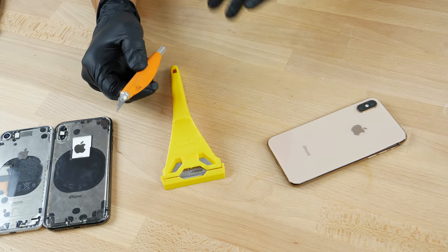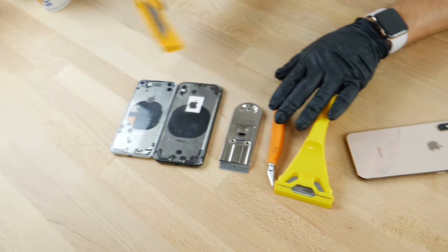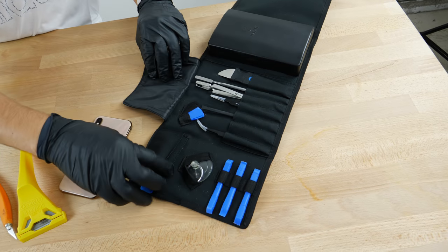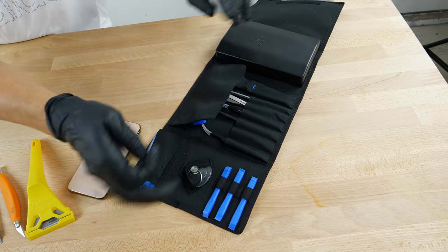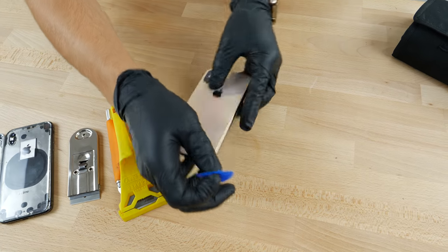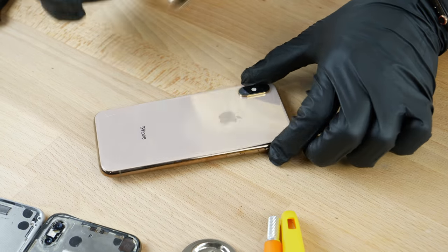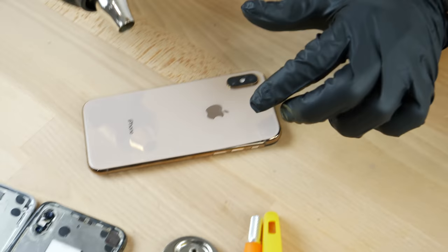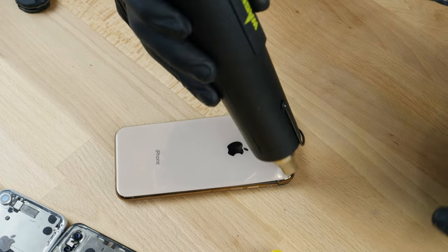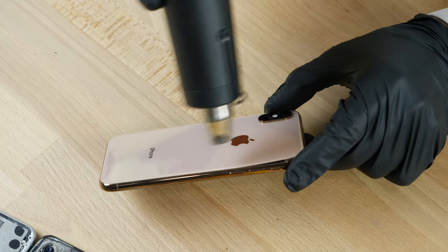This is going to be a shame because I'm getting rid of the gold color, but hey, I still want to see what it'll look like. Got my X-Acto knives, more razors, spare razors, and let's start with the prying. I'll be using these little picks — these do wonders for the back here. And of course some gloves so you don't end up scratching yourself. But before that, we do need to warm it up a little. Heat really doesn't do much here, but it does help a little bit. If you were to put some rubbing alcohol in there, it would weaken the bond, which would have been better. So we're going to go around the edges where we're going to start scraping — that's where you want to heat it so your little pick can get in under there.